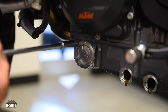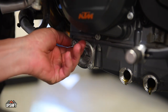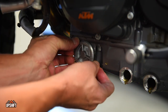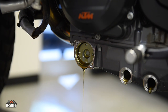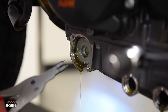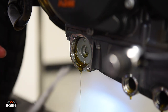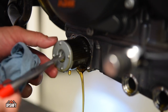We're going to take the oil filter cover off, and unlike our screens on the other side, these can't be reused. So anytime you change your oil, you want to replace this oil filter. To get the filter itself out, if you have circlip pliers, these are the best bet because they squeeze out and let you pinch it. You can also take needle nose pliers, put them in there and open them up to put some pressure on the outside — that'll also work. Just whatever lets you get a bite on it and pull it out.